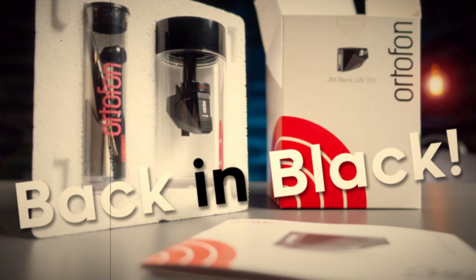After having reviewed the 2M Black LVB 250 in a previous video, it seemed only right to review its moving coil counterpart. As with my previous review, I won't be going into all the differences between a moving magnet and a moving coil cartridge, but the gist of it is this: in a moving magnet cartridge, a magnet is attached to the end of the cantilever to transfer the record's vibrations to surrounding coils, which in turn send that signal to your phono preamp. In a moving coil setup, there are incredibly tiny hand-wound coils at the end of that cantilever that send your record's vibrations to a much larger and stationary magnet. This results in a moving coil cartridge that is generally more agile and capable of detail because of its lower mass cantilever assembly and fulcrum point.